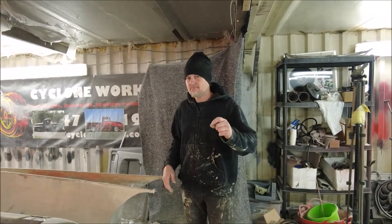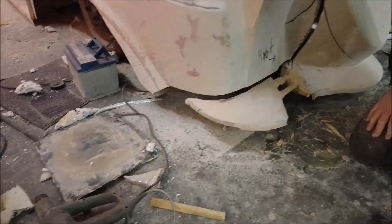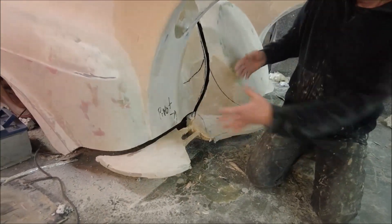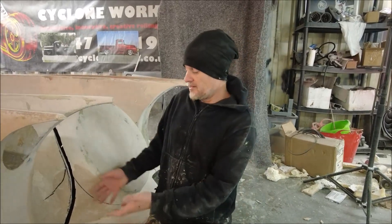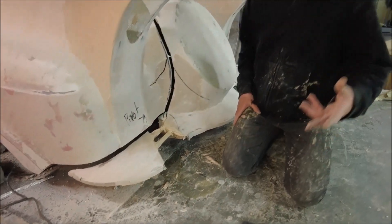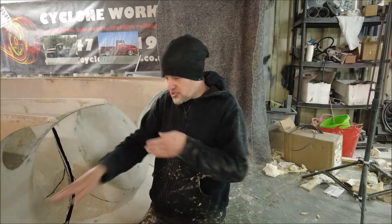So for the first time today — bit of luck, I think. Basically, I've bondoed these on and to get this in here — it's all very wobbly and flimsy at the minute. And this does swing under. I've had to cut a lot out here and I'm not sure what I'm going to do there — I have to make something to hide the gap so you don't realise that bit moves. But all of this bit has worked. This swings under, doesn't catch the pivot, this all clears, this tucks nicely, it opens fully out. So what I'm going to do now is fill this with foam, go have some lunch, and when I come back the foam will be set and I can re-sculpt this and start glassing in and making this all more solid.